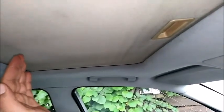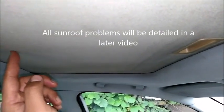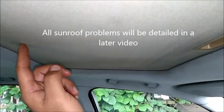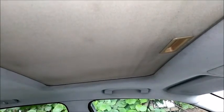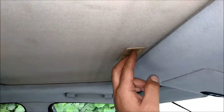And if you want my opinion, and it's not mandatory, you don't have to open the whole sunroof up to the end, where this edge will go beneath the headliner. I recommend that you open it until the handle is here. It's up to you, but you will hear that so many people have sunroof handling problems. It's not an easy job. It's not a joke. Removing the glass itself, calibrating the glass after you remove it, the mechanism, the plastic, buying, ordering, it's not worth it. So close the sunshade before you open it. Close it, it will open by itself.